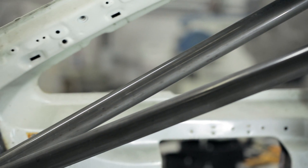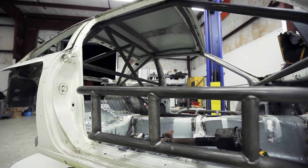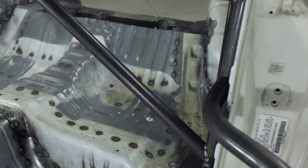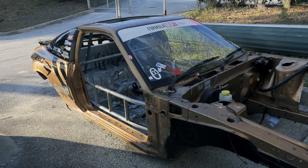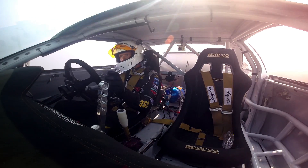The main hoop is in there tight, all our forward bars are up as high as we can get them with the dies that we have. It works — it's got me in the car with plenty of headroom. It tucks up a little bit tighter in some areas, and now I've got almost a NASCAR-style door bar where it actually kicks out up into the door framing itself. I have a lot more room to get in and out of the car compared to last year's, which was more or less just a straight ladder bar down the sides. It's so much easier to get in and out, especially with a full suit on, a helmet — if there's ever a fire or some kind of leak, I can get out of the car as quick as possible because I've got all the room to duck under and go.